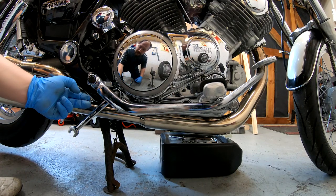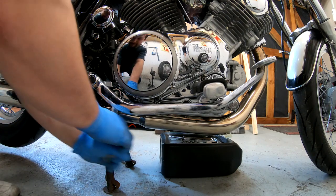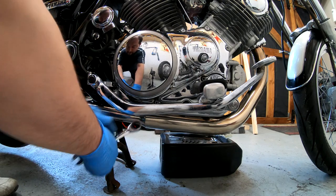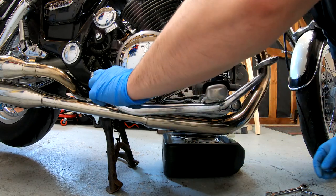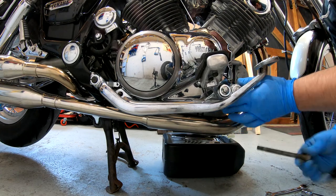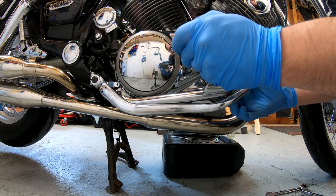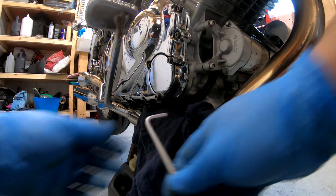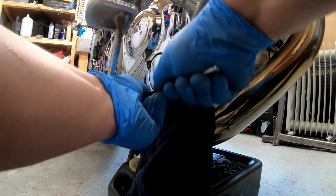All right, we're going to take that off first. Make sure the exhaust is cold — that's okay. I already loosened it up a little bit. Take that nut off, slide the bolt by hand, there you go, and this whole thing should just come out. That's it. So you need a 5 mil allen key and then just loosen up.